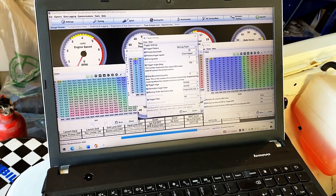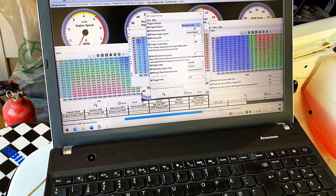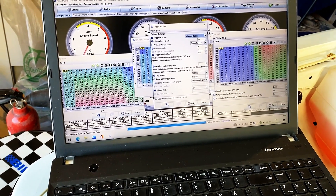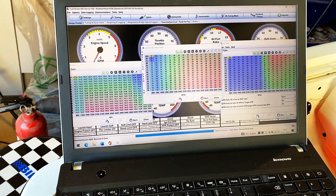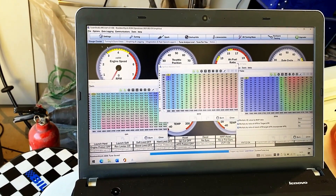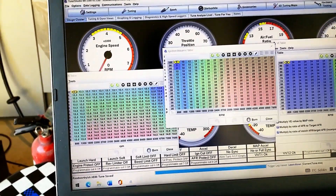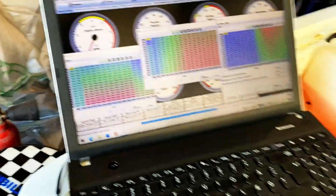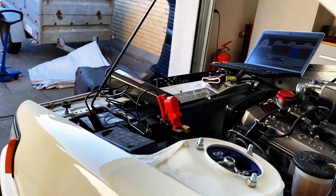I had an issue with the ignition — I wasn't really sure it was where I needed it to be, so I had to check it a few times. I'm not going to be the guy who does the timing gun thing all the time because it really sucks to look at, but you get the idea of what needs to be done. Also, if you copy any of these numbers for your own Speeduino builds, please do, but only use the fuel and ignition tables. Don't use the trigger degree settings and stuff like that, because that is unique from engine to engine and my setup is not going to be the same as anybody else's.